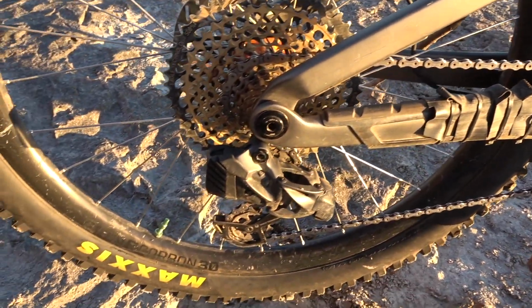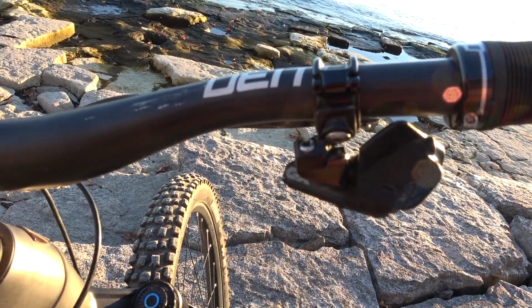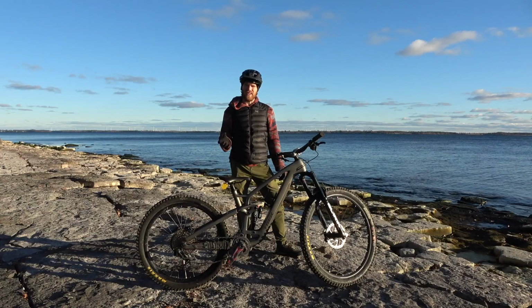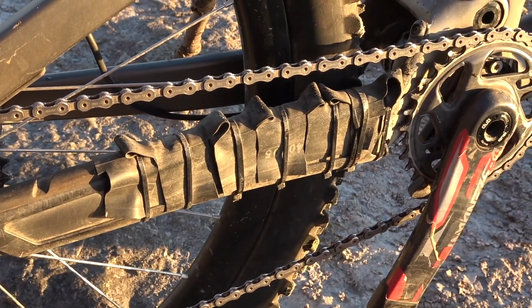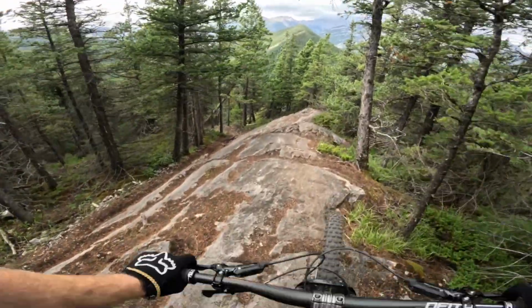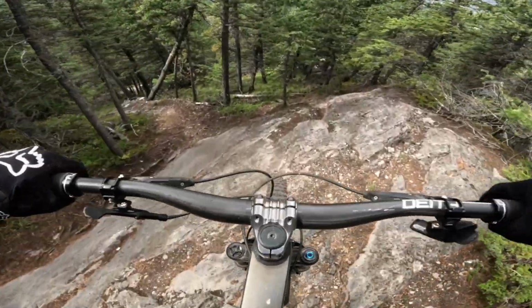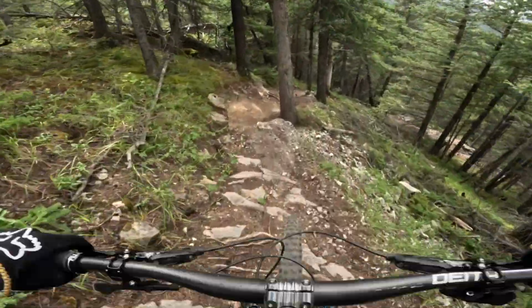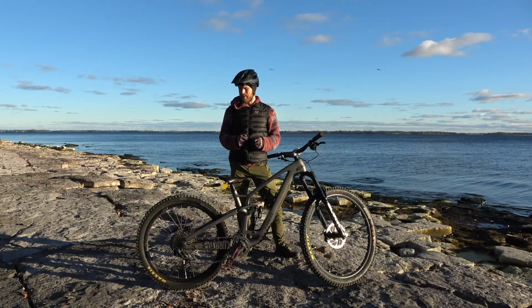This was before Transmission came out. I really want to try the Transmission. The downside to this version is that it bounces around a lot and it makes a lot of noise, that rear derailleur. I added a folded up tube to the chainstay to try to dampen some of the chain slap noise, but a lot of the noise is coming from the derailleur itself, just bouncing around, so I can't really get rid of it. I have had a few annoying chain drops as of late as well, so maybe a new T-Type drivetrain is in my future.